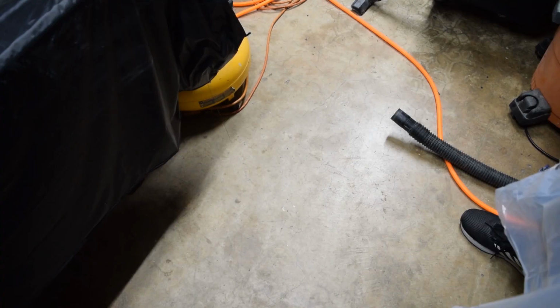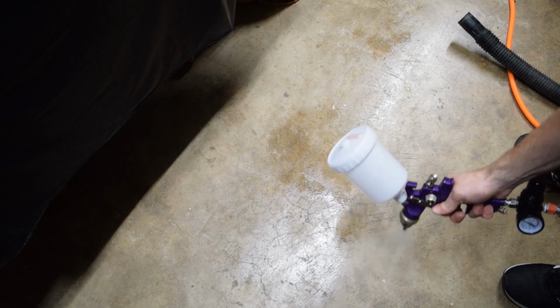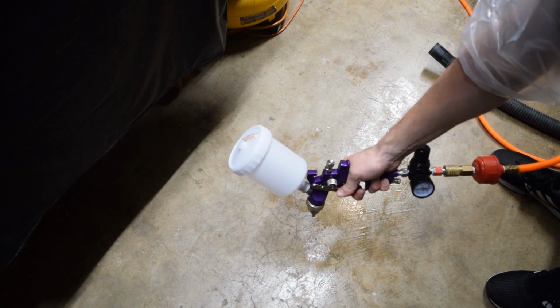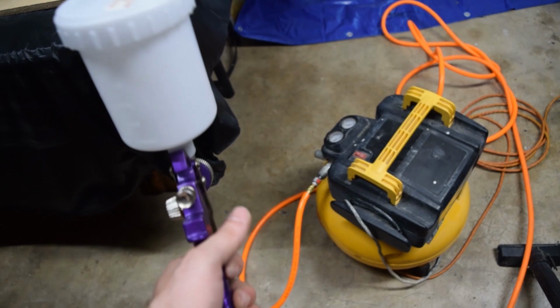Before using actual clear coat, I will be utilizing the lacquer thinner. I pour a good amount into this gun, swish it around, and then spray to make sure, one, that my gun is clean and working functionally, and two, that if there's any other residual dirt, grease, or moisture, the lacquer thinner should be able to take it out. Once the lacquer thinner has been completely depleted from my container, my gun should be clean and completely prepped